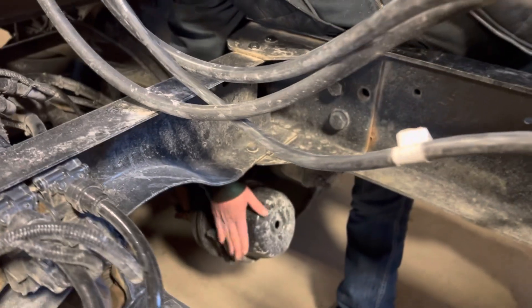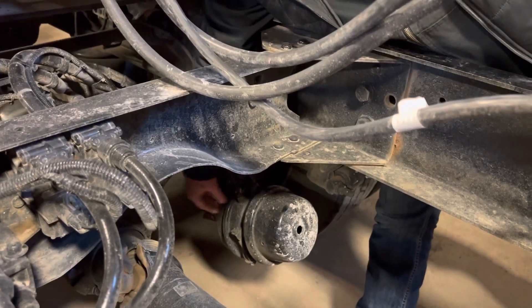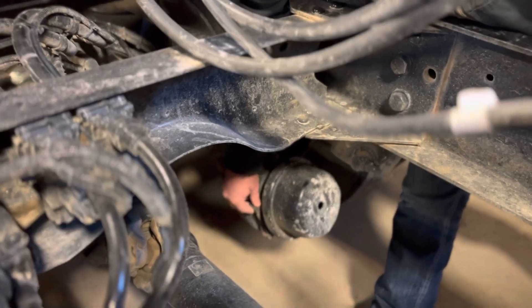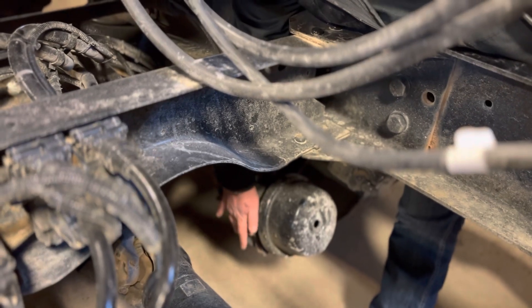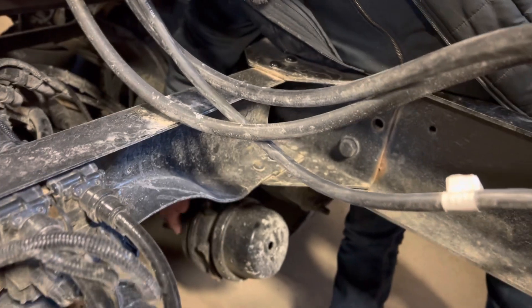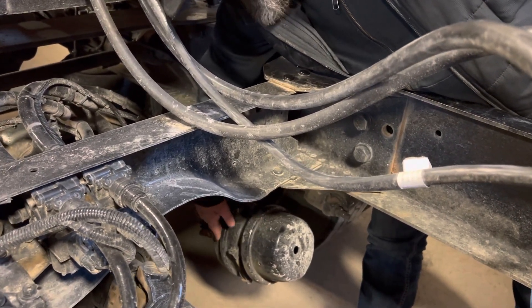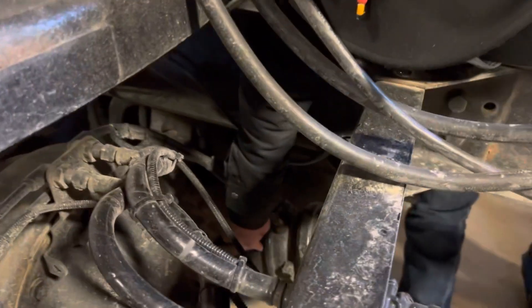Brake chamber. I have a front piece for the brake chamber and a back piece, and the C-clamp is right here. The C-clamp is not loose or missing. There are no missing nuts or bolts or shiny threads. There's no space or gap between the brake chamber ends, and it's not cracked or dented. I'll listen for air leaks right here. The brake chamber is securely mounted.